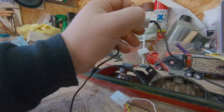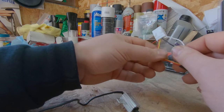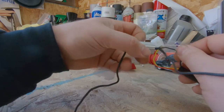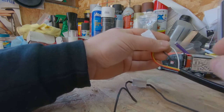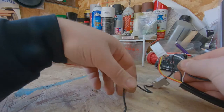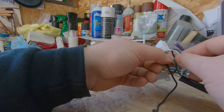How you install these: on our black and white wires, this is why it's important to know which wires are power and ground. We're going to take this resistor and go in-line — it's going to be in parallel with the light itself. So we're going to put one connection here and one here to create a parallel circuit that adds load.